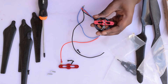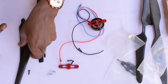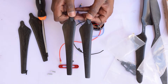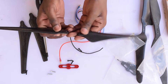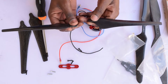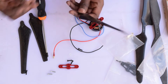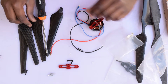Now the next step is to get your 1760 propellers and make sure that they're facing the same direction. When they face the same direction, you will have them not opposing each other — so if you have clockwise or counterclockwise propellers, make sure they match each other. That's very important because if you do it the other way, you may have a bad day.